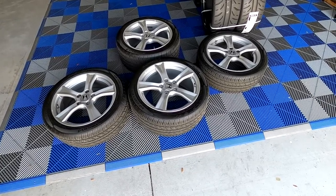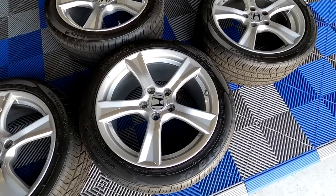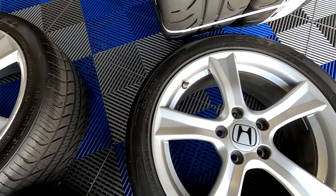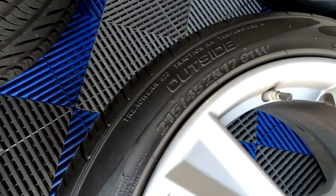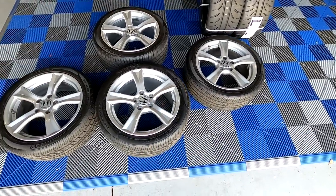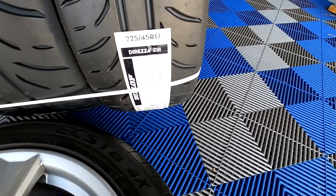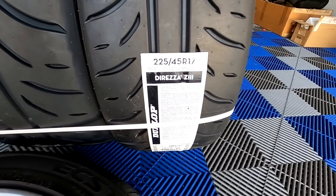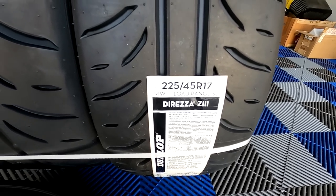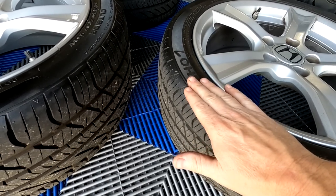This is what the wheels and tire combination looks like. I showed this on a past episode but I'll show you again. These are just a very generic economy tire and they're kind of old - they've been sitting for a while so they've got flat spots and it does feel bad in the car. First off, you see tread wear rated 420 - that's not going to be good for a turbo car at all for any kind of handling. The tire I settled on: front and back we're going 10 millimeters wider, so from 215 to 225 on the front, and then the back we're going to 255.